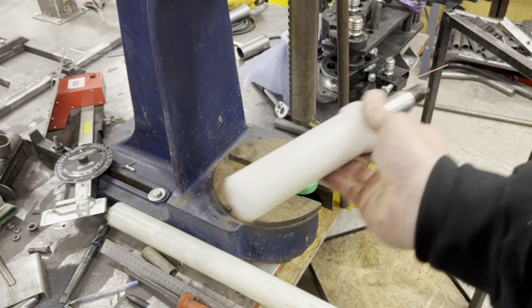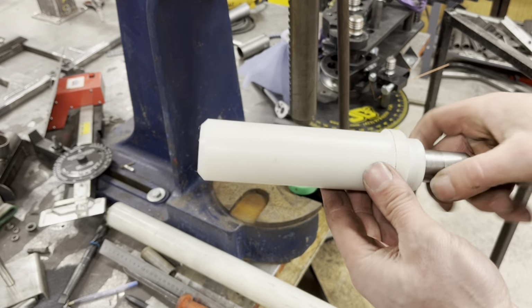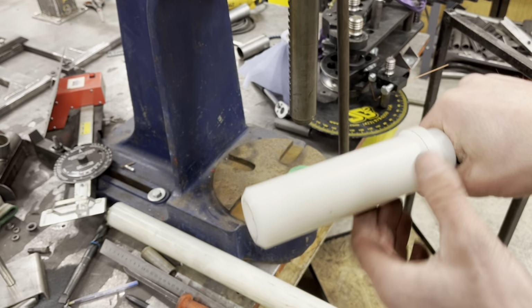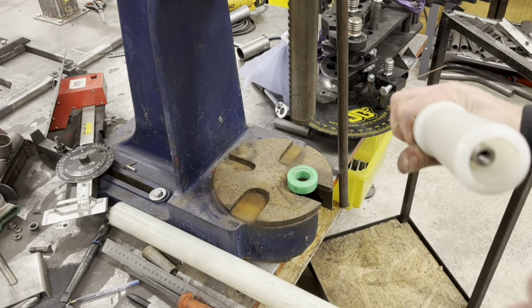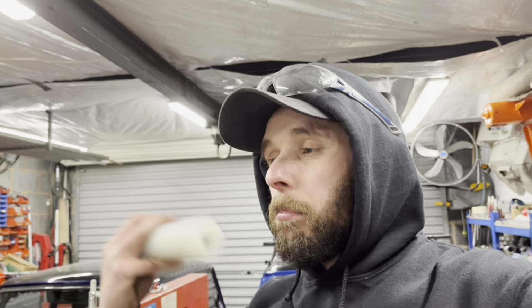So that'll press into the 45mm tube now. But what I'll do is I'll grab that in the chuck and just make sure that that's to the diameter, because it would have spread because we've been shoving that in there. Right, I'm going to call that video here because it was my own extended time and this took a lot longer than I thought, because you can only take so much material off this because it splines up everywhere.